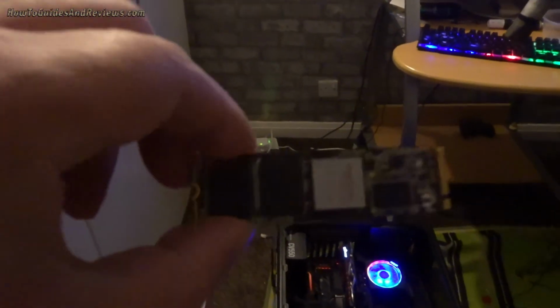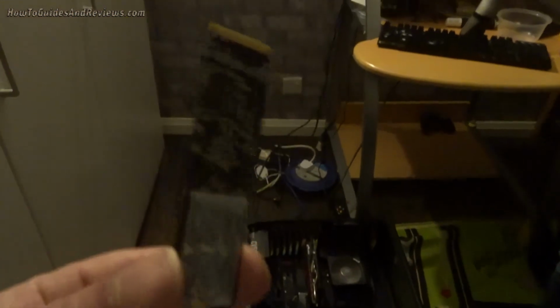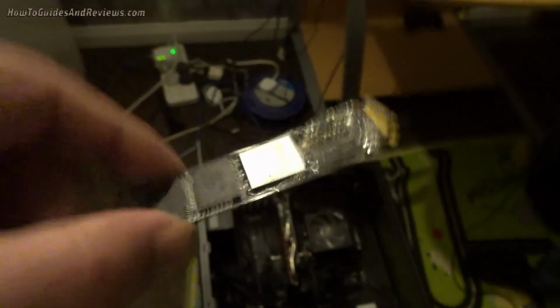There you have it. Corsair MP600. If your system's not booting, you've got NVME2 and it's a Corsair MP600, that's the reason why. Unfortunately you cannot disable NVME2 ports, so the only solution is to take it out. Get it replaced. This is what I'm going to do now. Scan Computers gives me grief.